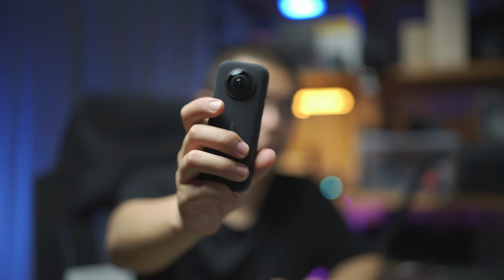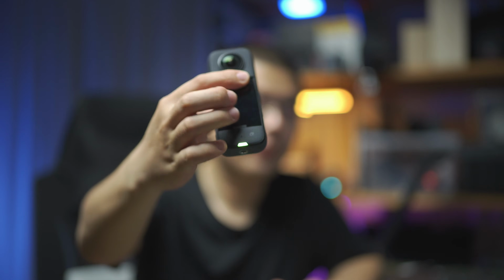But things got a lot more interesting on the Insta360 X3, because not only does the X3 have better audio performance, but it is also a hybrid camera. It consists of a 5.7K 360 shot as well as 2 individual 4K single lens action cams. And with a better design in this 4 microphone pickup array, which is the front microphone, the back, the left and right, this is a brand new design for the microphone pickup array that has a better, longer baseline that makes it more capable when we perform the beamforming technology. So basically speaking, the X3 has the best audio experience that ever happened on Insta360 cameras, and that is why I am so fascinated by the X3 in my content creation.